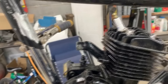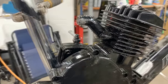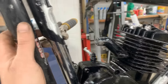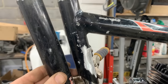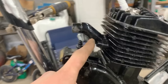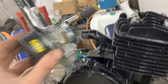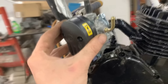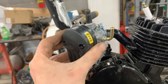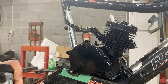So I started thinking maybe if I cut this pipe off and just put a pipe behind it, just like that maybe. But again, this is aluminum, I can't weld anything. Even this is aluminum. I thought maybe if I can shorten this intake, but even that is aluminum. So now maybe if I make an adapter and make it fit like this on an angle, that's not gonna be too bad. Okay, so it's the next day and I think we found a solution here to our problem.